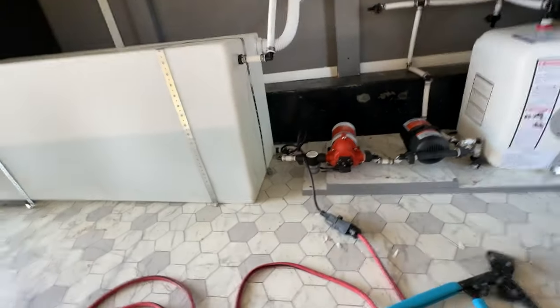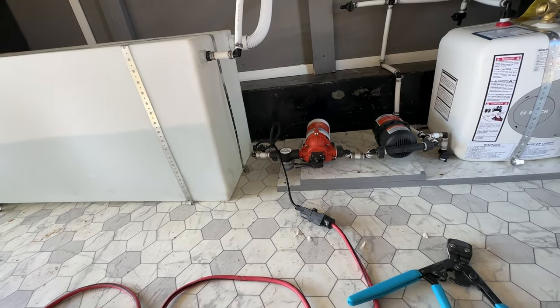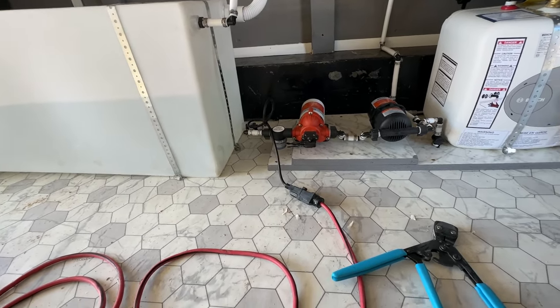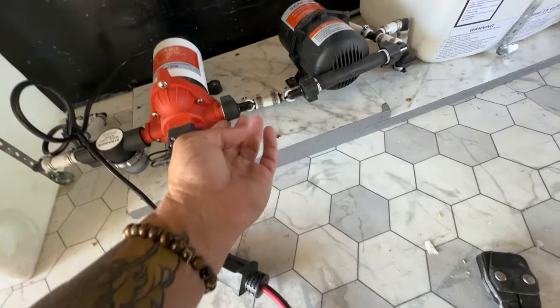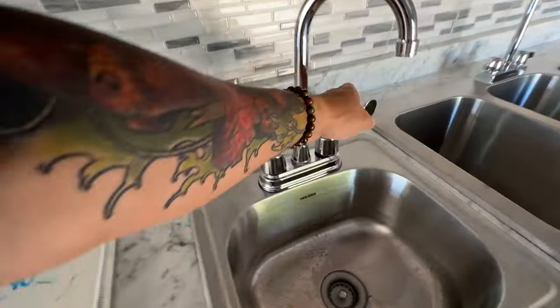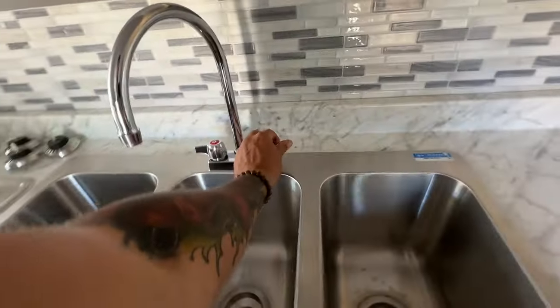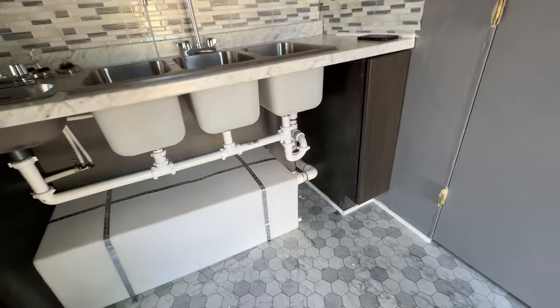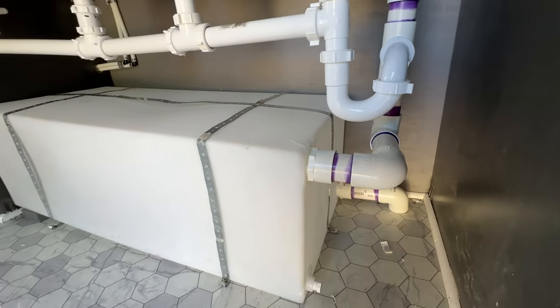Then it comes down to testing everything out. With everything crimped, glued, and tied down, work on both your inlets — attach a garden hose to the three-quarter inch and use a bottle to pour water into the gravity fed. Look for any leaks. Once the fresh water tank is filled, plug in your pump, turn it on, and it'll go out to all your faucets — that's where you'll start seeing any leaks. Make sure you have rags because there are always leaks somewhere. Turn on your faucets, verify they work and drain into your gray, then go outside, open the RV drain valve, and make sure everything flows out without leaks.